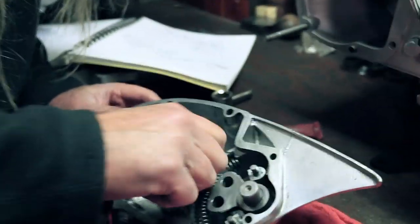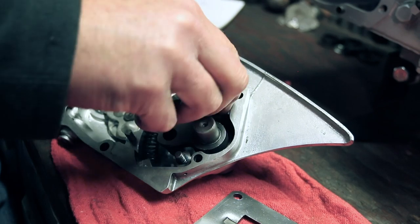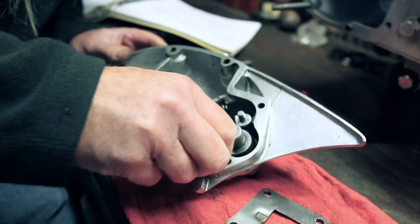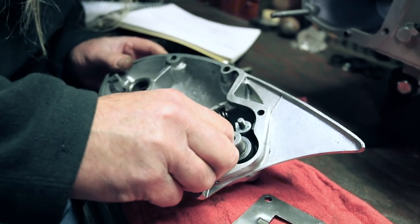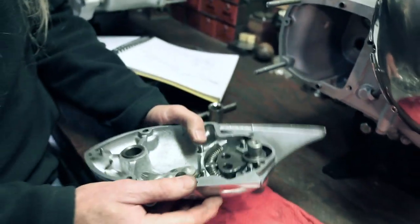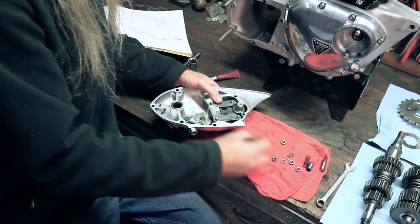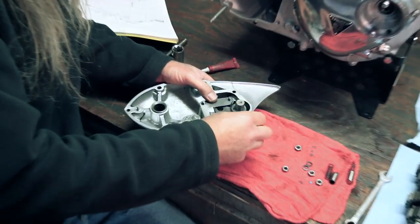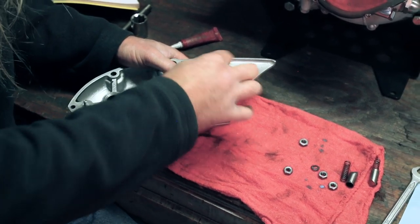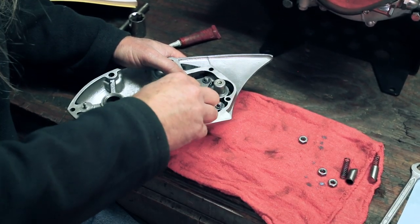And you can see the Loctite oozing out around the holes, so you know it's going to work. And see, they're all bottom to that edge. That one's not. There we go. Okay, so we've got all those Loctited. Then we're going to put this plate on top. And a serrated washer on each one. Followed by the nut.